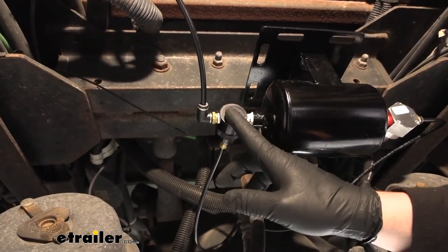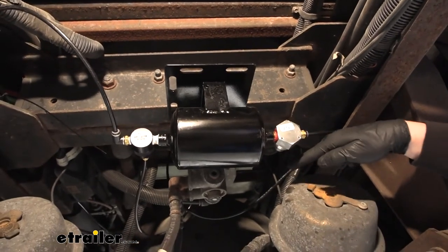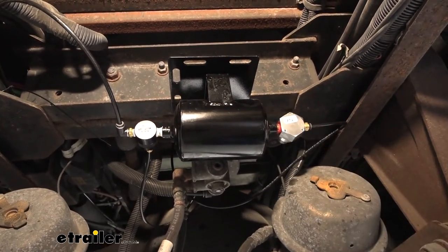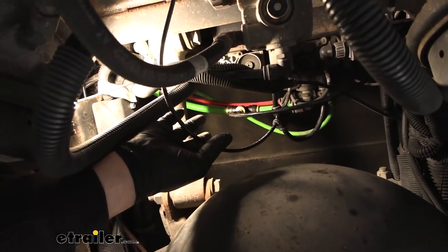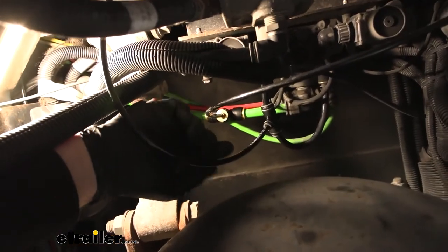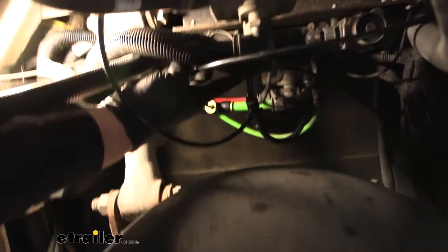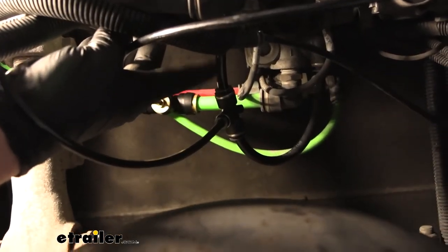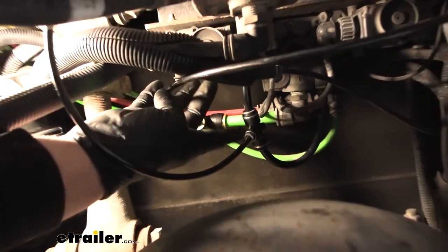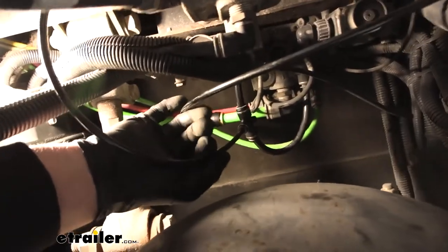One airline goes to our supply line, one goes to our metered air, and one runs all the way to the back to our fitting. Let's focus on our supply line and metered airline first — these run essentially just a foot or two towards the back and up where they connect to the motorhome's factory airlines. The metered airline is generally the smaller line. A way you can check is to unplug it — you should only get air pressure coming out when you apply the brakes in the motorhome. You cut the factory line in half, use the included tee, tee it in, and plug in the airline from the metered air port on our tank.